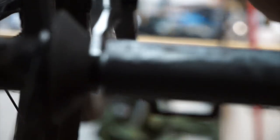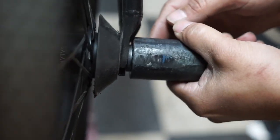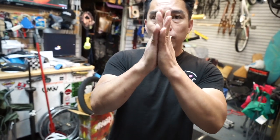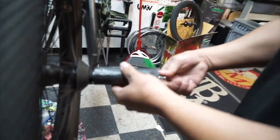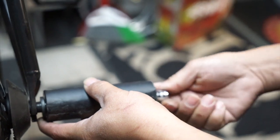Now, some people are going to sit there and go, you know what? It doesn't hurt. You're right — you can leave that in, because when you turn it, sometimes it won't rotate the whole peg. But that's on the inside. What you don't want to do is you don't want to leave the washer there — that's what's going to happen. Some of you might think, what's the big deal? Here's the big deal: that little space is going to give this thing room to move. And every single time you hit, it's going to move, it's going to bend the axle because it's not sitting flush. Everything you want to be tight — you don't want it to be a little loose. Even if you lock this thing down tight, because there's room for it to move, every time you hit it'll move a little bit and bend your axle. So remove that. Common mistake. Some of you guys that do it, don't feel bad — majority of people do that. Even there's been shops that do that. That's why you want to go to a BMX shop. You don't want to just go to a bicycle shop because they don't ride BMX, so they don't understand.